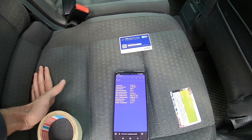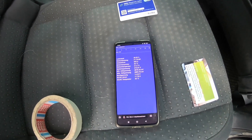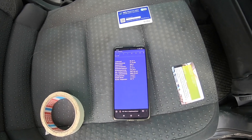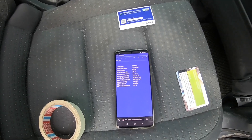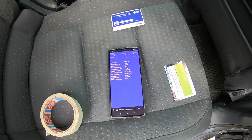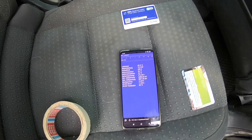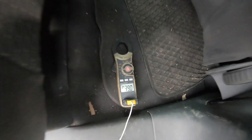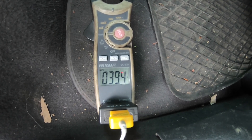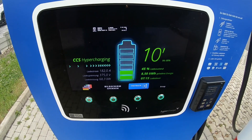We're dropping in power. That's my charge curve — it's already cutting back because it's approaching 3.9 volts, which is the first CV point. Let's go to 45 percent and see what kind of cable temperature we get. I'm also running my newly installed fan now to keep the battery cool, but it's already gone up by 5 degrees from 17 to 22. So within just seven minutes we have added 8.5 kWh to the battery — that indicates the charge speed.